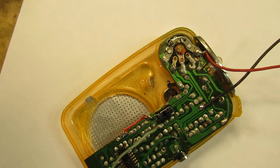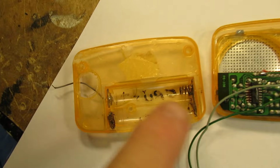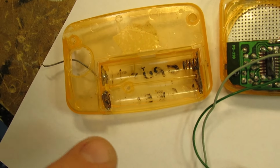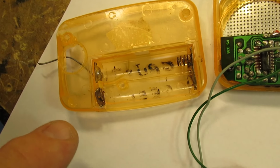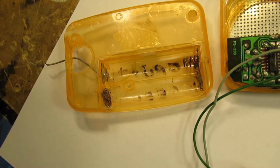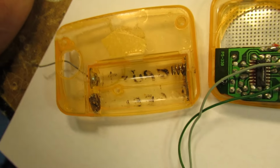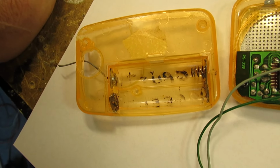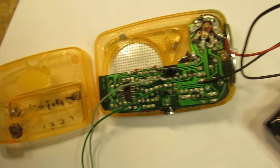Anyway, like I told, the plastic deteriorates. Here is the backside of that radio. Also a big problem is always that the battery holders are corroding. That means that you must shake that radio to get it working, to make a kind of contact, and because they work on 3 volts, that is extra critical. On such a low voltage, even the tiniest contact resistance will have the effect that no current can flow into the radio.